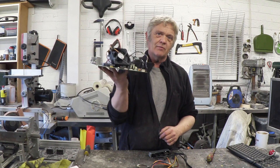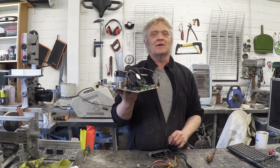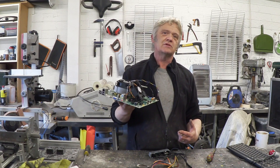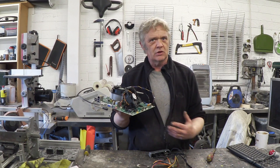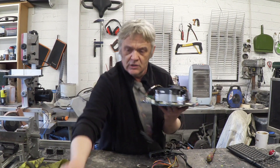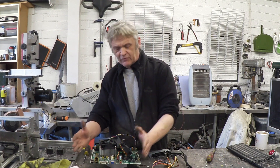The final bit is the motherboard - it comes out as one whole piece with about six screws. Lift it out, but resist the temptation to expose it to huge amounts of static. If you're wearing a nylon jumper or have nylon carpets and walk around in bare socks, you could give it a shock. Try to lay it on something non-conductive - a bit of cardboard works fine. Just leave it to one side and don't unplug anything, so you don't have to remember where it all goes back.